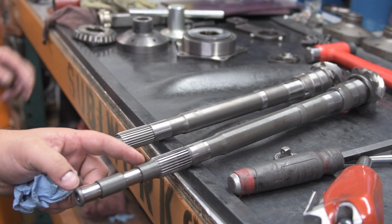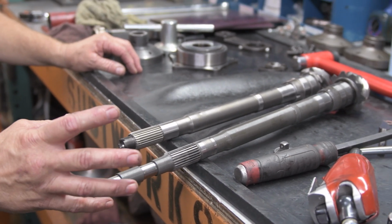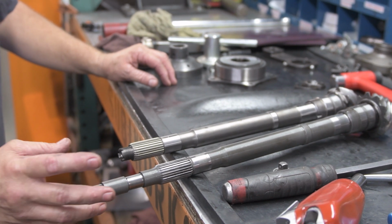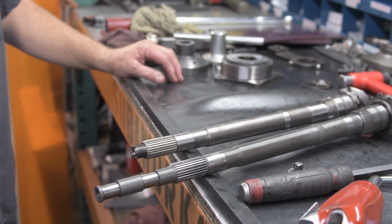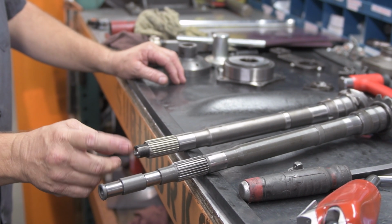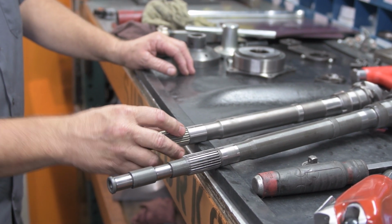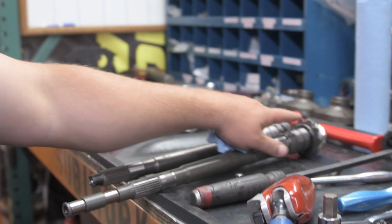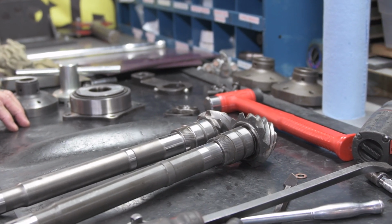First up is what I'm gonna call the pinion shaft, because I don't really know the exact name for it, but it's essentially the pinion gear connected to a shaft that goes through the middle of the transmission. And Subaru Gears designs one specifically for their rear-wheel drive conversion. Normally these transmissions have a center differential that transfers power to the rear wheels. Subaru Gears designed this for a two-wheel drive application so that there's a coupler that transfers the power from the gears directly to the pinion shaft.